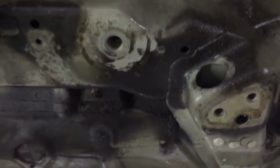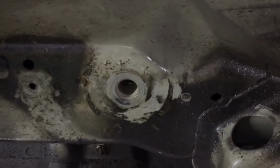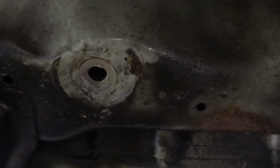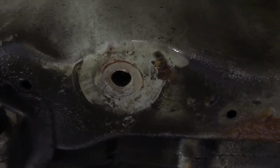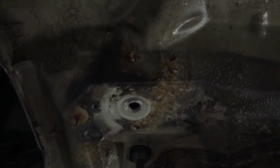So we've got some cracks occurring. Got a little semicircle crack around that left front mount there. This is the right front mount. We've definitely got a semicircle crack around that one, and a spot weld failure just onto the right, and a little crack coming out of there. There's an example of corrosion which we need to attend to, get rid of all of this. And this is the right rear subframe mount, lots more corrosion. At the moment no cracks, but we'll see more once we degrease.